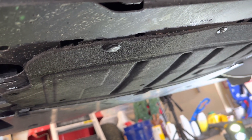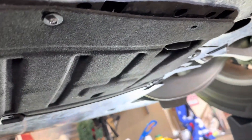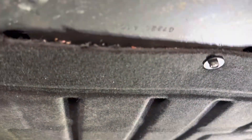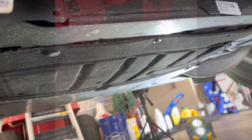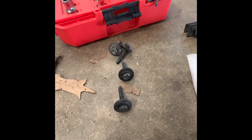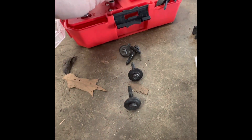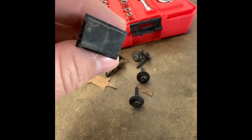One of the first things we have to do is remove this underbody panel. You don't have to remove the belly pan in the front that's attached to the bumper — you just need to remove this fabric one towards the middle. The screw sizes from the underbody panel are seven millimeter screws. You'll have some circle clips to remove; you can use a fishbone pry tool. Then you'll have two square clips to remove as well.